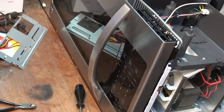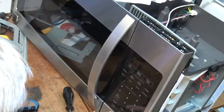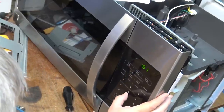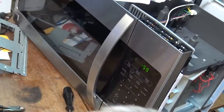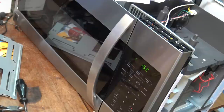Let's set this thing and heat some water up for one minute. The microwave comes on — heating up our glass of water to verify that everything is working. But then when I opened the door, it tripped the breaker. So we have a primary switch issue. The cup of water is hot, so the microwave is working, but I'm going to have to pull this apart again.